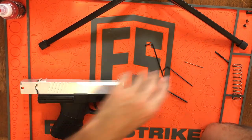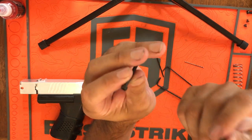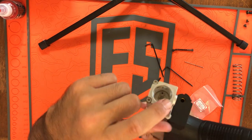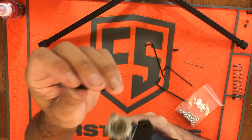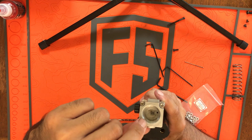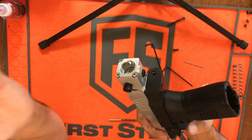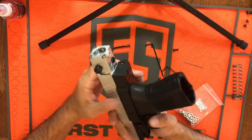The factory Allen heads are not. So the stainless that you saw me installing is actually stronger than these grade 2 Allen heads that come factory. The stainless 304, or 18-8 as it's otherwise known, is about a grade 5, so it's already stronger than the factory bolt, and I'm not too concerned about that.